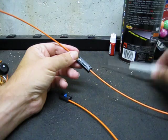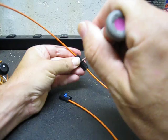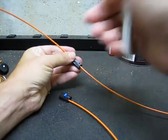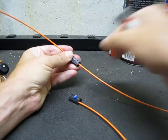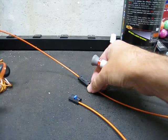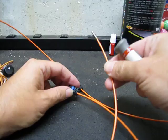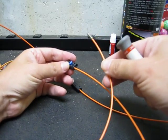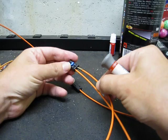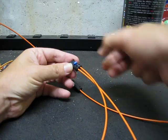If you had to take it back apart — if you made a mistake or anything like that — you can just insert a screwdriver at this point right here, take it apart, and pry the little fiber piece out just like you did before. Then you're going to take the connection from the i-tronic harness, the other one that has nothing on the end of it, and insert it back into the factory plug, pushing it in until it clicks.